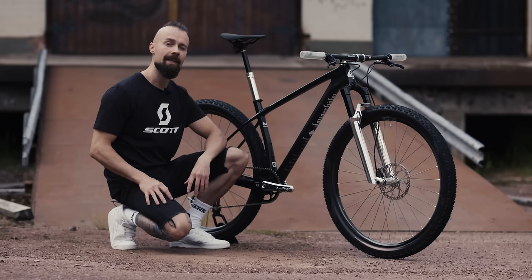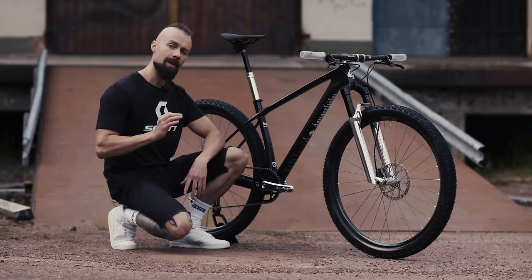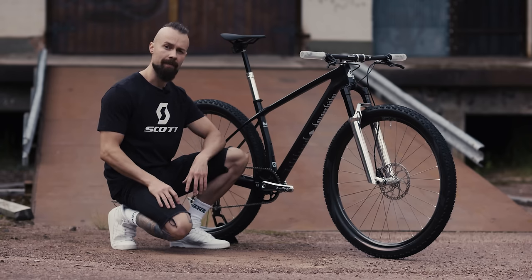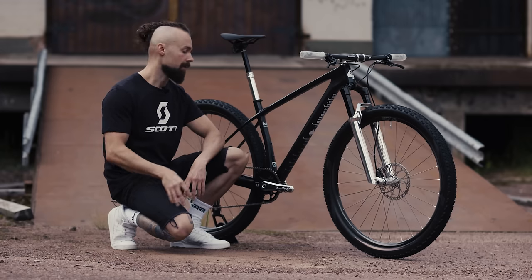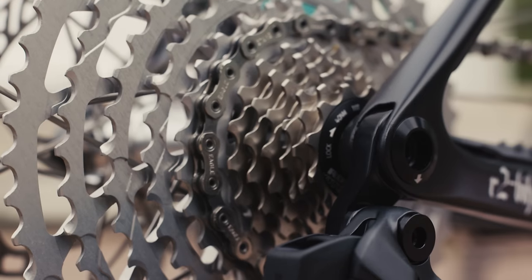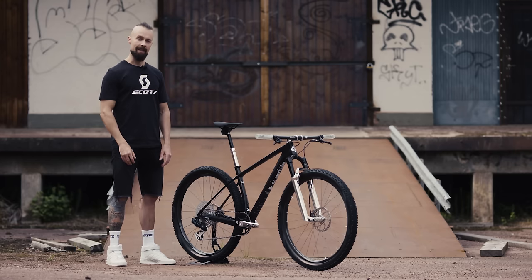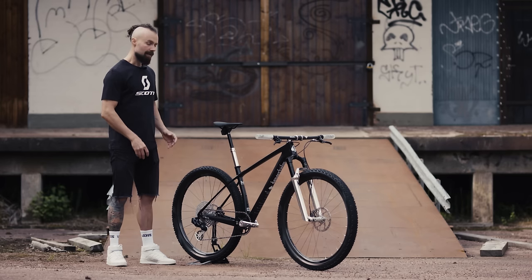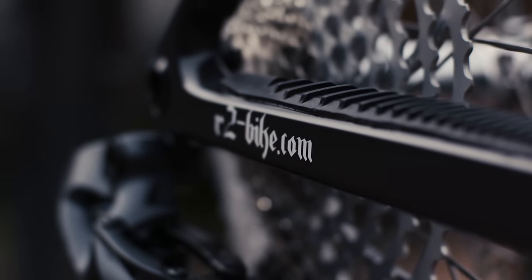To squeeze a little extra performance out of the bike, it's equipped with a Kogel ceramic bottom bracket. Some people think that ceramic bearings are a little bit overkill on a bike, but really high quality bearings like these are quite durable and really easy to maintain. They're available either with low friction seals, mostly for road or dry weather use, or cross seals like I'm using here. The chain is a SRAM X01 and the cassette is an 11-52 from Rotor. I started using these cassettes last year and I've really been loving them — they are lightweight, super smooth shifting, and also available in several sizes. One thing to note though is that they are only available with HG freehubs, so that means 11 tooth is the smallest cog, but the good thing compared to 9 or 10 tooth is that you get a little better durability and also a little less chain friction.